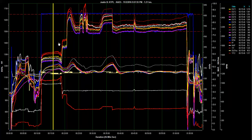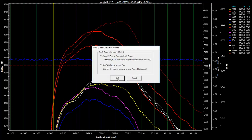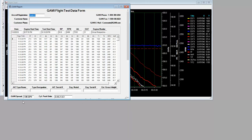You didn't really climb too far. Now let's get to a portion here — we see the number three CHT. You did a GAMI check right here. I'm going to scroll in on that and we're going to look at this GAMI test. We can see we've got a big difference in the engine. Let me run the GAMI test here — 1.06 gallons.